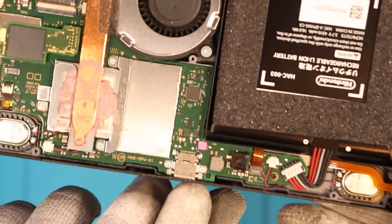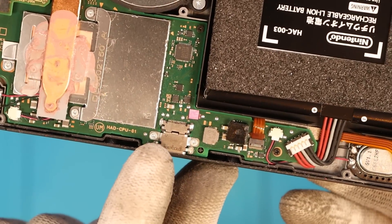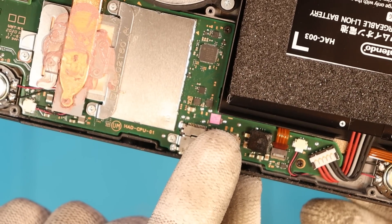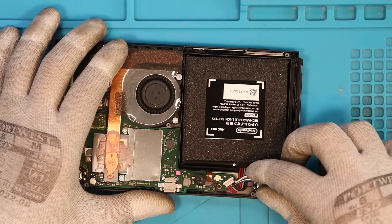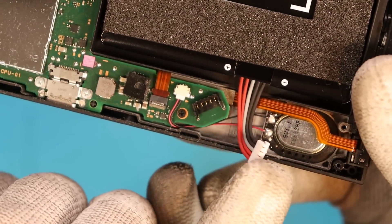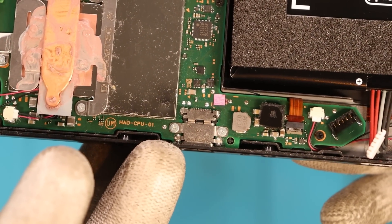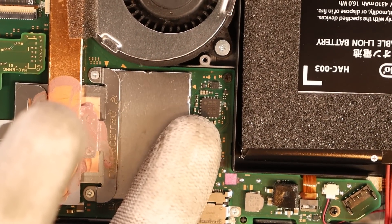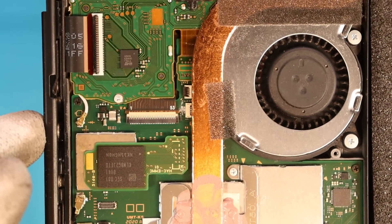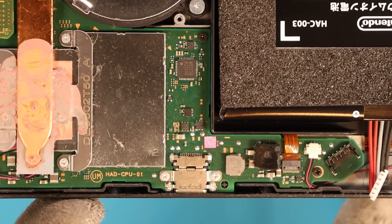First impressions after opening: this little pink/purple bit of paper is a water indicator. When water gets onto the main motherboard of a Nintendo Switch, this will turn pink — usually it's a solid white. First things first, we definitely disconnect the battery. It doesn't look like any water damage has gone onto the battery, which is really good. I'm thinking the water's gone into the port and may have blown the M92T36 charging IC. I'm going to carry on taking this apart and get the board out of the chassis.